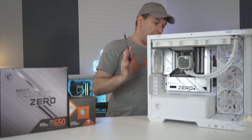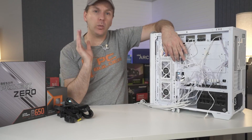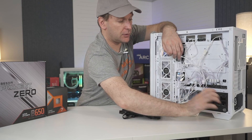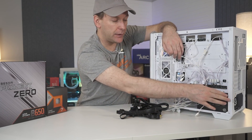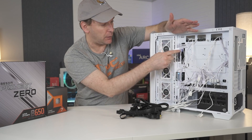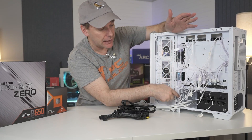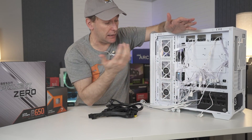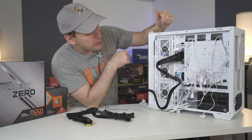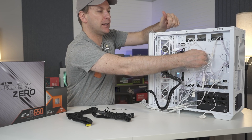The build has been super easy so far. We're getting the PSU installed next. Typically I would pre-install the cables into the PSU, but since cable routes here are quite short and the PSU is fully modular, I'm going to plug the cables into the motherboard first, figure out the runs, then plug into the PSU. The 24-pin looks like it might be a bit of a pain — not a lot of clearance here. My recommendation to MSI would be to add some kind of L-bracket on the back so the cable lays flat and doesn't stand off.